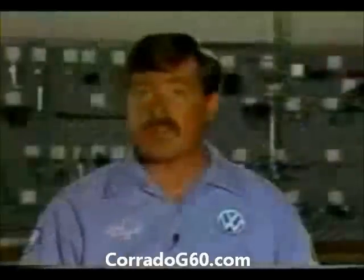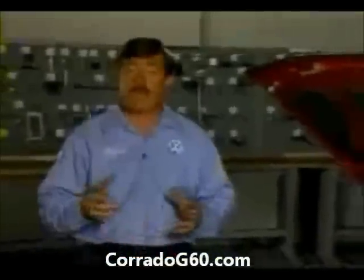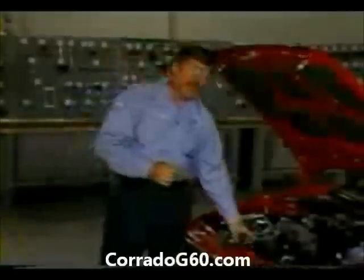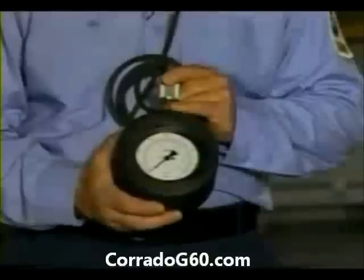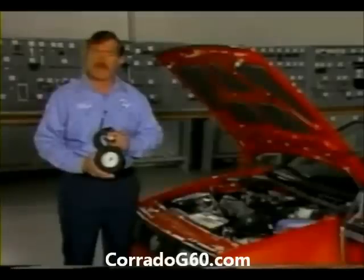Now that we've talked about the operation of the G-Charger, let's see what's involved in checking the G-Charger's output. To do this, we'll need to locate the pressure gauge VW 1397. This is the same gauge you use to check the boost pressure on the turbo diesel Jetta models. Before making any boost pressure checks, make sure that the basic engine settings are correct, the idle setting and the knock sensor are okay, and that the engine is fully warmed. With the engine off, connect the gauge to the vacuum line for the fuel pressure regulator by using a T-adapter. Always use hose clamps.